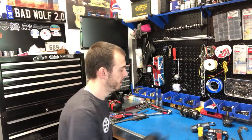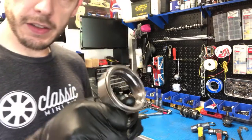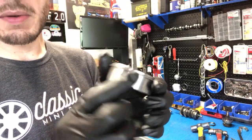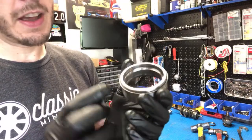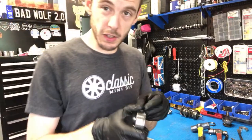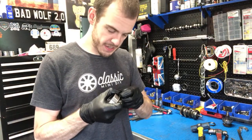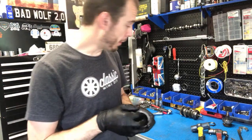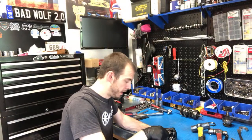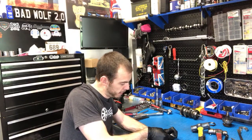Drew's Page says greeting from Brighton — hello, thanks for joining the stream. Now one thing when you're working on your gearbox: this retaining ring — your double roller bearing normally has stuff inside this retaining ring right here — is something you want to keep. You can reuse it when you're rebuilding a gearbox, so something worth mentioning. I wanted to keep mine before but it broke.